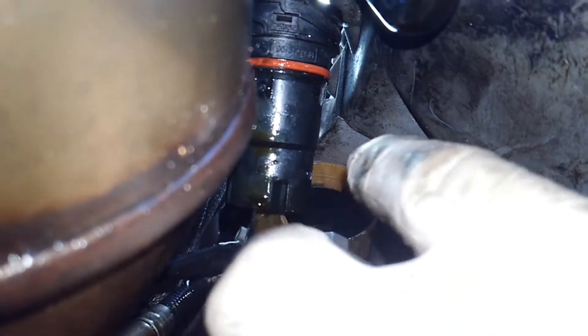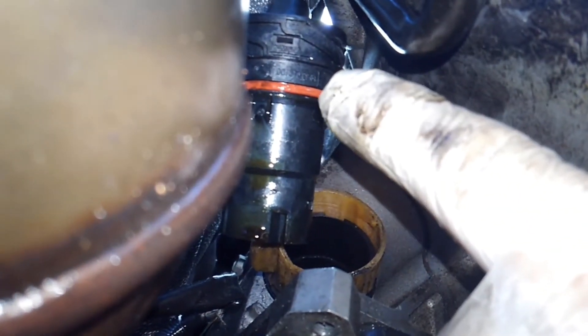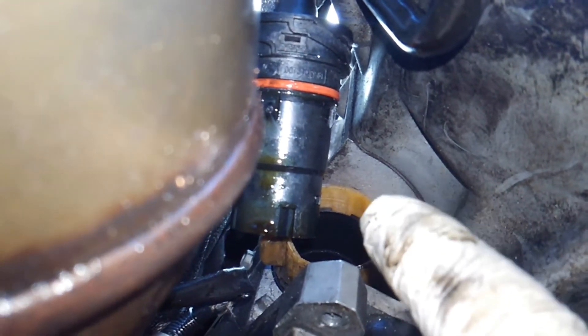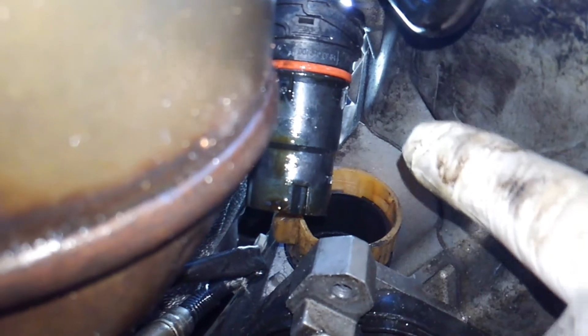There's oil under there, which means one of the o-rings failed. That's bad for this one because it's the one that can wick transmission fluid up to the transmission control unit, the TCU, under the passenger floorboard, and start causing transmission problems.